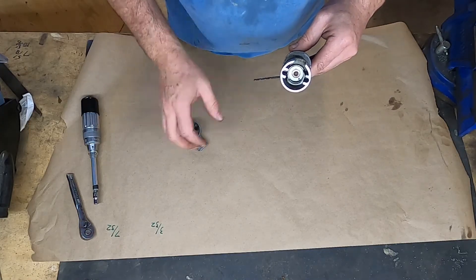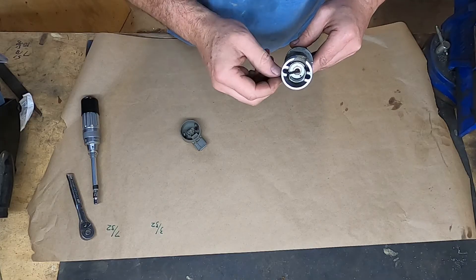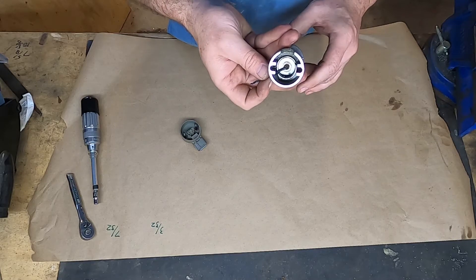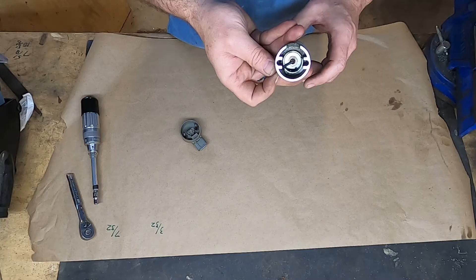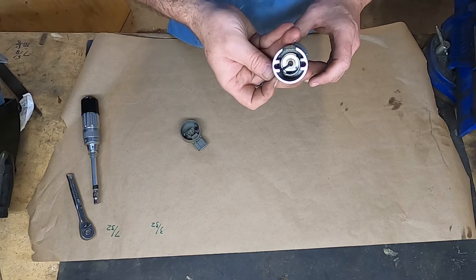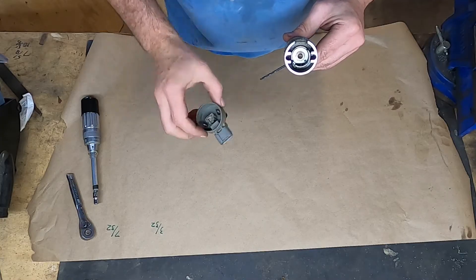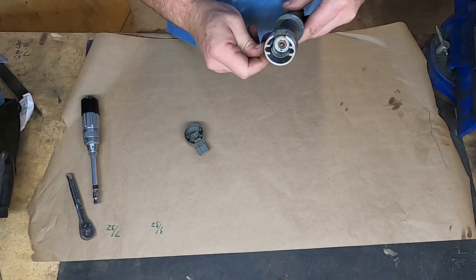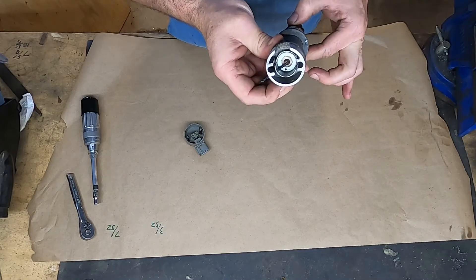Something to be very careful of: if you don't take this cap off and make sure you lock it correctly, there are some positions where you can slide the drill bit through but the sensor can still rotate inside. The best way to avoid this situation is to actually take the sensor off so you can make sure you pick up the correct hole in the aperture so it doesn't rotate.